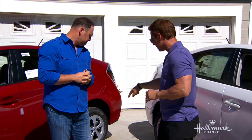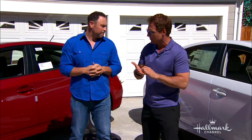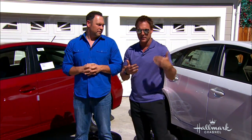Check your tire pressure at least once a month. The tires on the side usually give you the air pressure reading, and if not, inside the door panel. Most people don't do it, and then they get out there in a situation and think, I'll just call AAA — which sometimes you can't. Check your tire pressure at least once a month because it's super easy. They also tell you to rotate your tires every 6,000 miles. These are basic things.